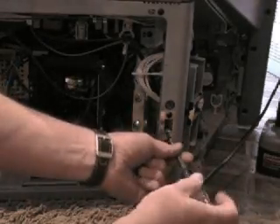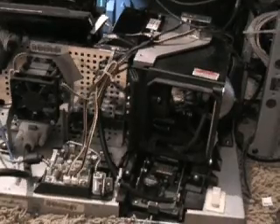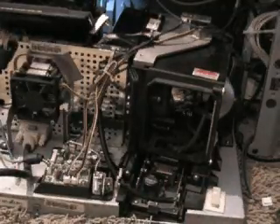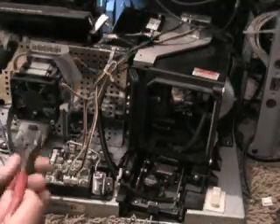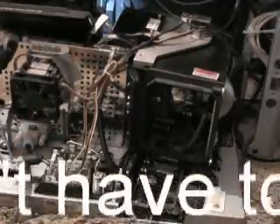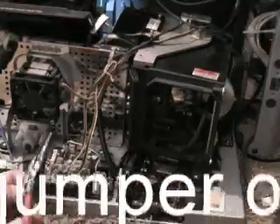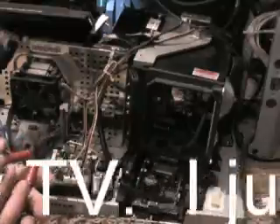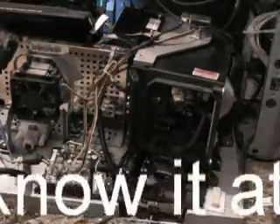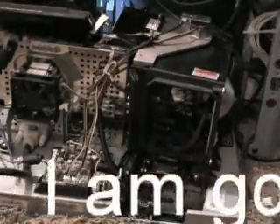The kids are home, as you can tell. So I'm going to screw this in. One thing I forgot to do on my first install — and just had to undo — there's a jumper right in here and you need to remove that jumper. Apparently from what I read, that jumper tells the television what type of bearings and what type of color wheel are in. So for my older model TV, I have to pull that jumper.